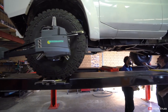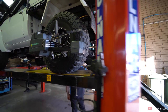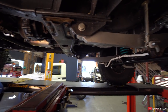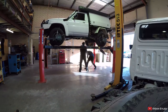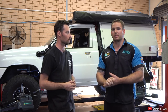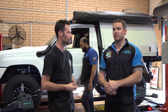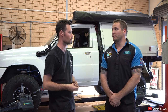Nowadays a lot of the newer four-wheel drives have IFS on the front — so for those guys, what's different with the front end when you do a lift? It's a totally different ball game. With IFS you've obviously got CV shafts which throws a spanner in the works. Most of those cars are generally limited to a two-inch lift before you've got to do diff drop kits and upper control arms. Beyond two inches they run a really long travel strut and the CVs go into bind and max out your upper ball joint, dragging the wheels in. Generally to do it right there are budgets for different lift levels depending on the application, but to do it properly at bigger heights you've just got to spend the money.